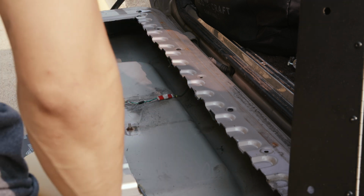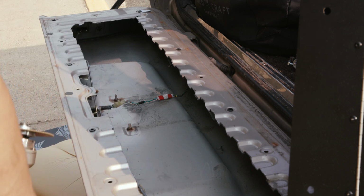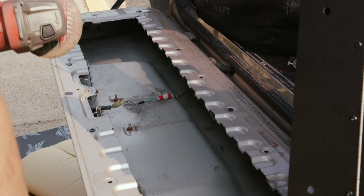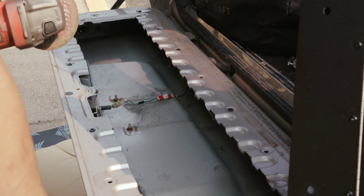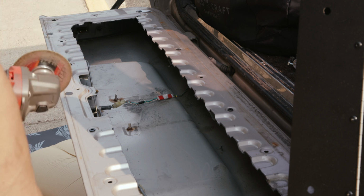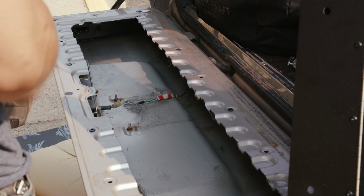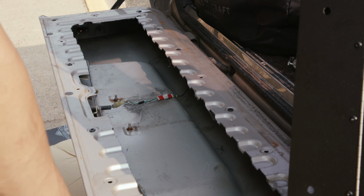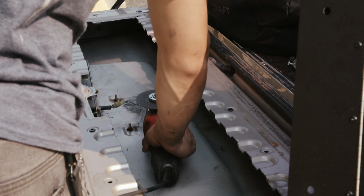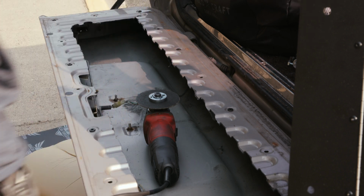But I mean, this is really risky because you're going to thin out that blade, and if you catch an edge, it'll blow apart and throw stuff all over you. Oh, sure. So you're going to want to make sure your watch has a sapphire crystal, because otherwise you can pit it with the sparks. Sure. Number two, you're going to get these little shreds inside your shirt from that kick out. Those are little pieces of razor sharp needle metal. So wash your shirt and your pants separate from your wife's underwear.